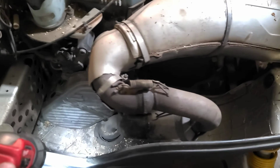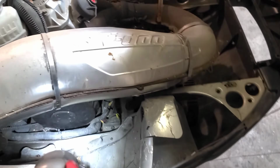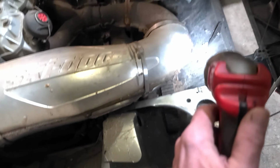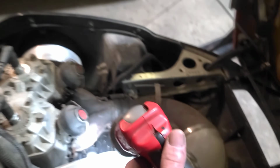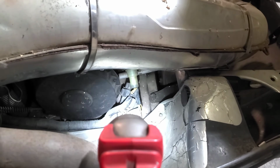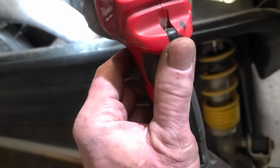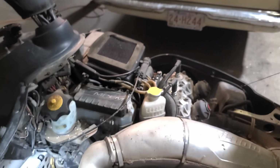So yeah, we'll go around to the other side. We're gonna look in the bottom of the belly pan here, see if we can see any evidence of any repairs being made. Just looks like it's been sitting for a while. I don't see any old rivets or anything like that. So that tells me this thing hasn't had major overhauls. Have a quick look at the wiring, look at the connections. All looks pretty factory. Doesn't look like anybody's hacked into it, which is a good thing.